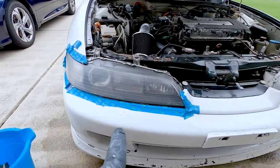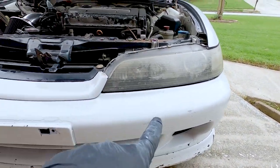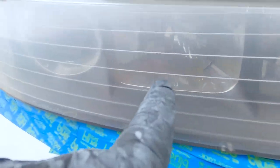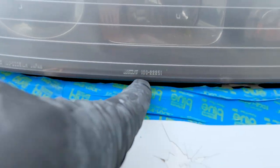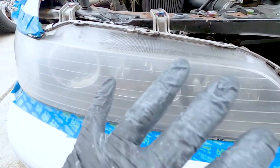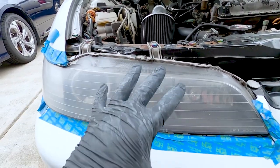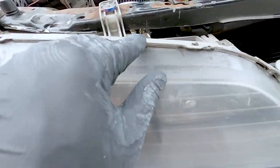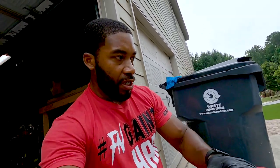Look at this headlight assembly — look at where we came from. That is all wet sand, no compound and no polish yet. Even now, wet sanding, I can see more things to address inside the lens: the chrome has started peeling. At least now you can see the lines in the headlight lens — you can see 'Koito,' you can see 'Honda.' This is a JDM nose cut, 94 through 2000, so the stress fractures aren't catastrophic. It looks like somebody had been in here before and just didn't do a great job.